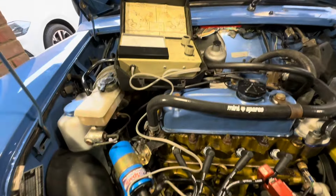You can see that we're in the low 9s now, and it's just starting to clip the 8s. So we can see that that carburettor is unable to control the fueling. And if you've got a carburettor like that, that is not possible to tune because you've got no baseline. So the remedy is either a new carb, or at the very least change the needle valve.